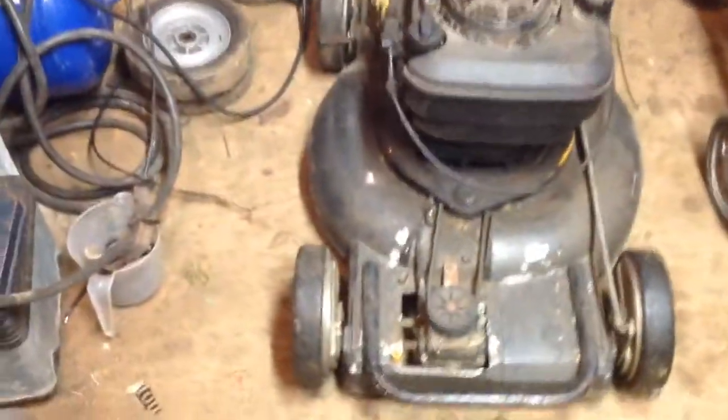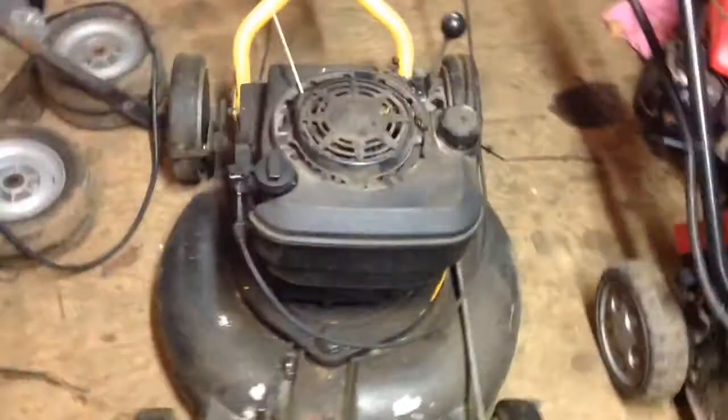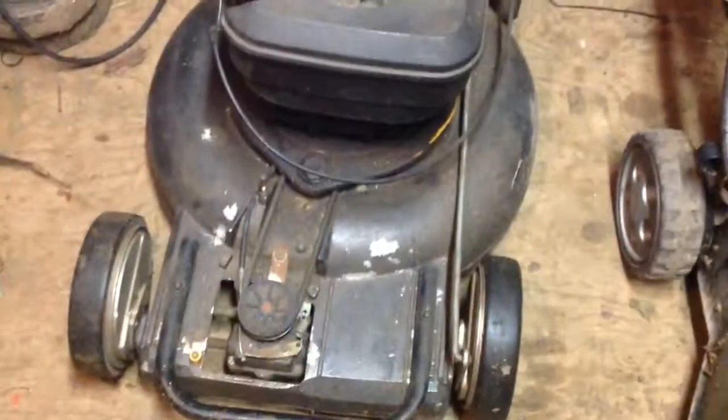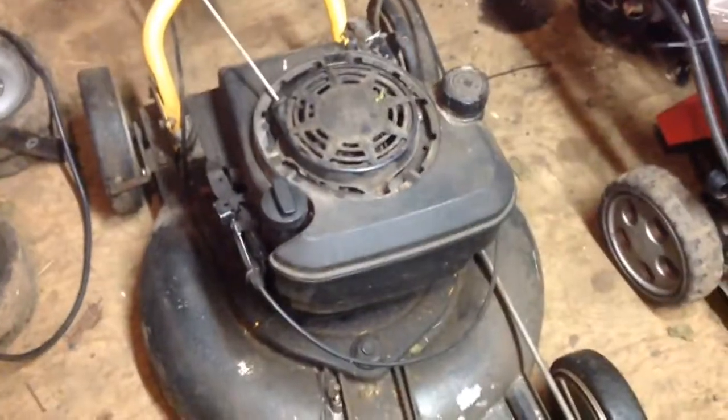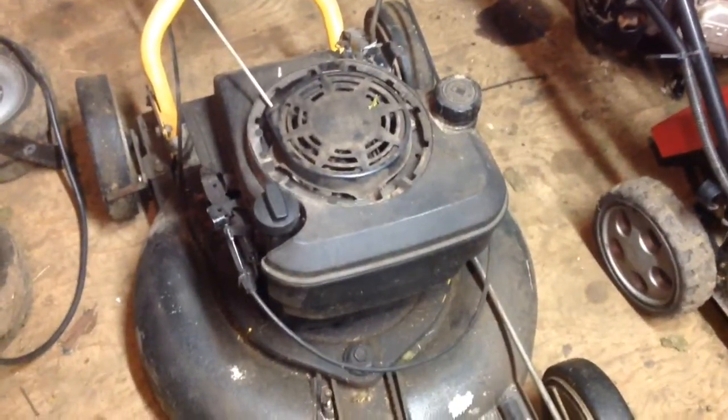The electric start one that I thought only needed a gasket has proved to be a bit of a pain — it didn't solve the problem. This is the self-propelled one I bought the other day. I've got all the bits. I thought the drive was jammed but it was just a cable so it wheels now. It's the same engine so I'm going to borrow the carb off of this one for now. I've got another carb somewhere else so I will be fixing this one, but at the moment I'm borrowing the carb off of this. The person said it wasn't running anyway so probably the carb was dirty — I'll get it off and see if it fixes the problem on the other one because I think it could well be the carb.